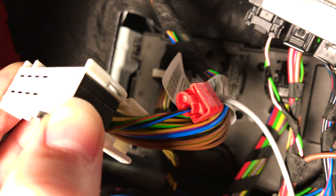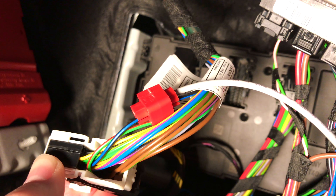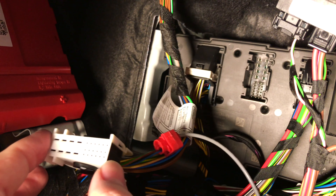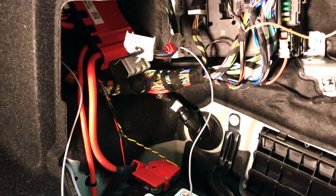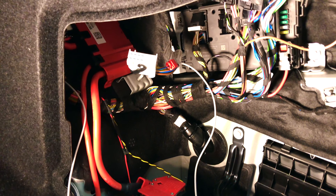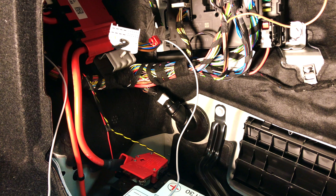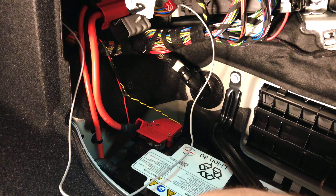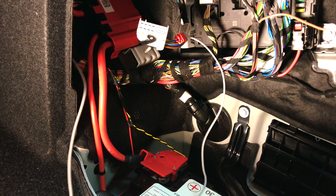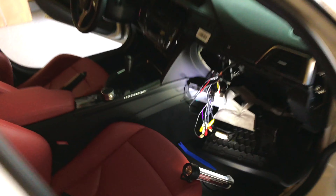While the gray wire is butted all the way against the front section that doesn't have a pass-through — it just stops — you want to have them engaged. It's a delicate balance, but you can do it. As long as you get this engaged, you will then be able to set the settings on the front of the car with the MMI modules and tell it to look for the rear view lights, so the camera knows when to cut on and off. It'll cut on when you put the car into reverse. Without this gray wire, it would not turn back off, so this is basically giving it an on/off signal based on the rear reversing lights cutting on, allowing the camera to cut on at the same time and then telling it to turn off.